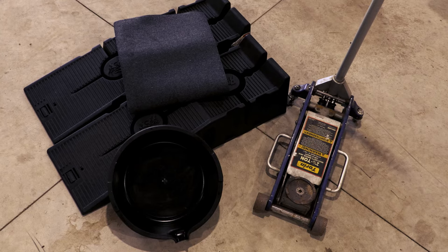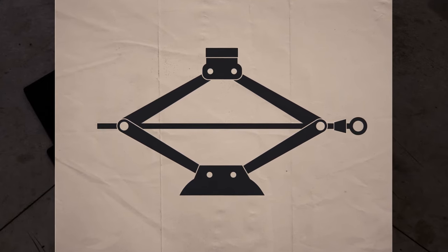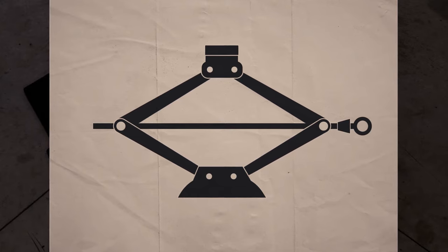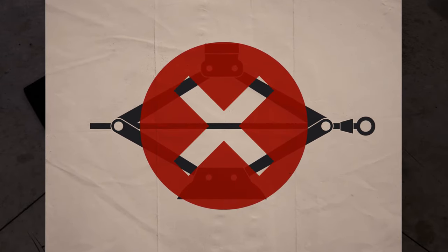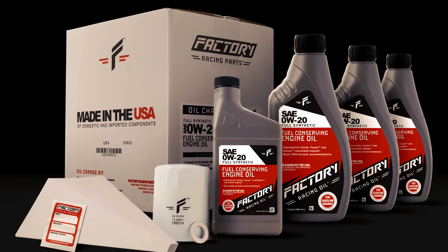The last things you'll need include an oil spill mat, an oil drain pan, and if your drain plug and filter are hard to get to you may need ramps or a jack. Do not use the basic jack that comes with your vehicle — those are really designed for short-term use like changing a tire in an emergency and not meant for someone to crawl underneath the vehicle with it supporting the car. An easy way to make sure you have everything you need is to purchase a convenient oil change kit. Check out our products page to see if we have one for your vehicle.